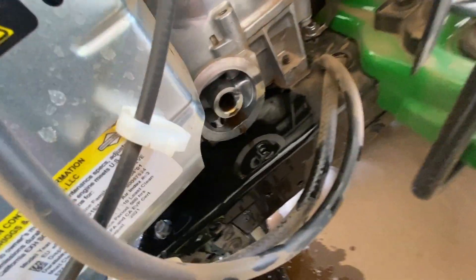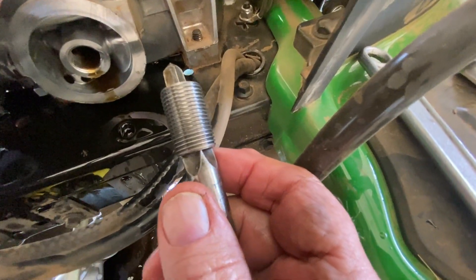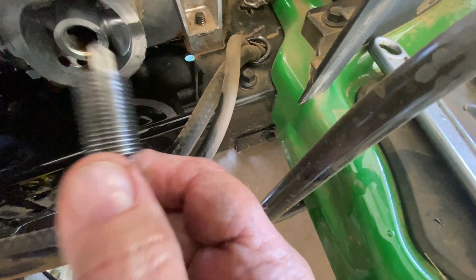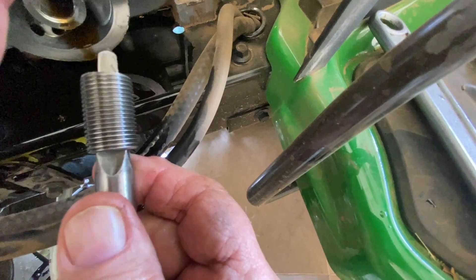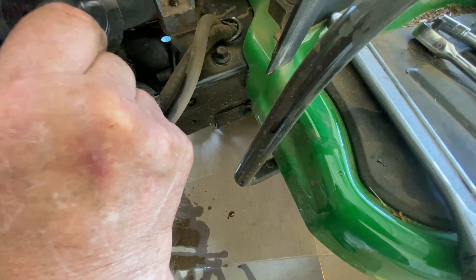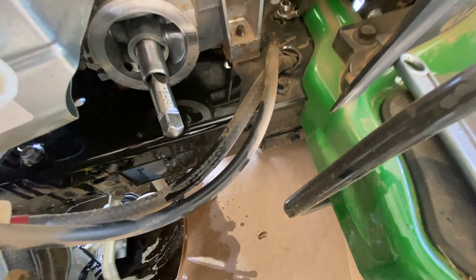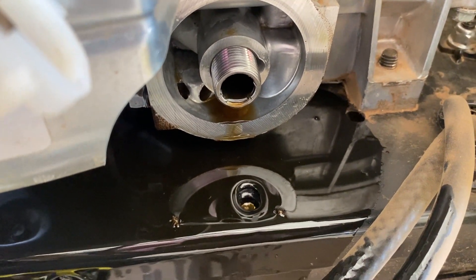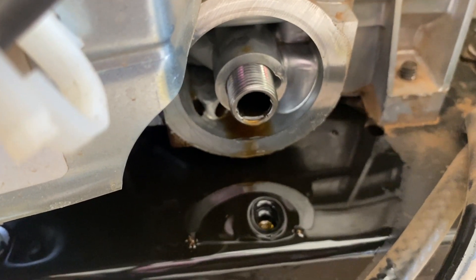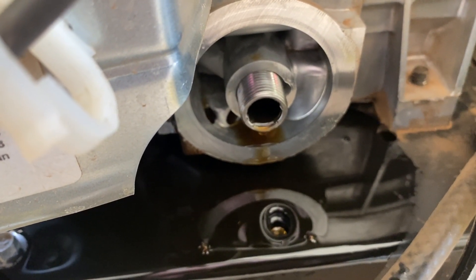When it's off there, it leaves you just your standard filter mount. The only thing is that little nipple that I told you about — you have to install it. You don't want to use pliers or vice grips on it. Get your ease-out, or make one out of a bolt like this, and that way you can install it. Get it good and tight, then just tap the ease-out on the sides and it'll come loose. Once installed and tightened down, just nice and snug, tap the corners of the ease-out or the bolt and it'll come right out.